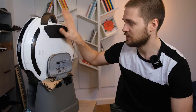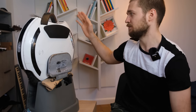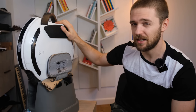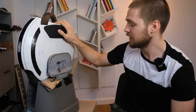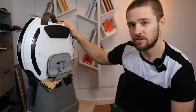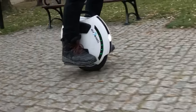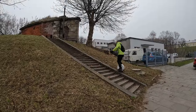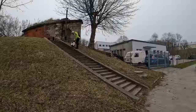First up is safety. Kingsong is well known for their safety and electronics. The BMS and charge board doesn't have current flowing through it all the time. There are fuses inside — if you buy from e-wheels you get an additional fuse in the box. If overpowered, there's a slight pedal dip so you can feel it out. There's also tilt-back according to speed, with a top speed of around 30 km/h, plus beeping and protection against extended hill climbs.